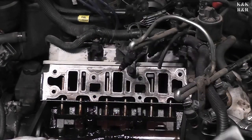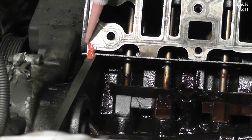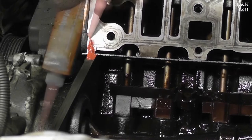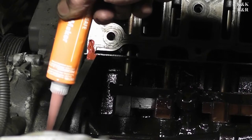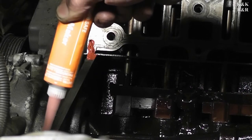We need to do a final wipe down real quick. Need a little bit of RTV here before you put the new one down — not a lot. This orange is good stuff; you can use black, but I prefer orange because it lasts longer and it's good against oil contamination. Put it at each corner. We've got to let this tack for a couple minutes before we put our end seals down.